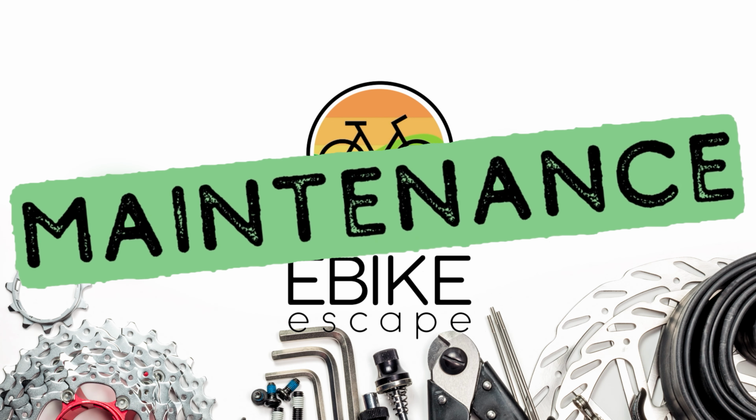Yeah, so first off, I want to say this is the rear derailleur. Now this piece here, that's protecting it. So right here is the rear derailleur. And one thing that I really want to let people know starting off is how it's routed around. I have seen it from the factory every once in a while to where it's routed improperly. So the big thing is that it comes around the sprocket, comes down around this sprocket or cog, if you will, and when I see it improperly run, it's kind of hooked through here, or could have another problem through this juncture.